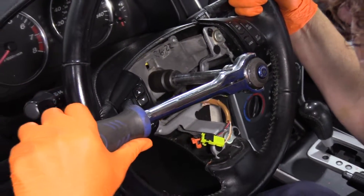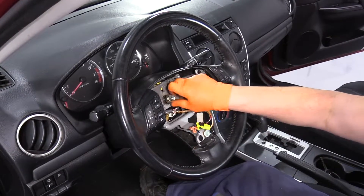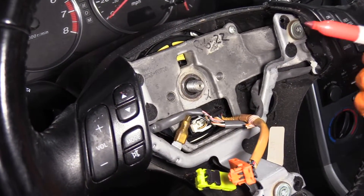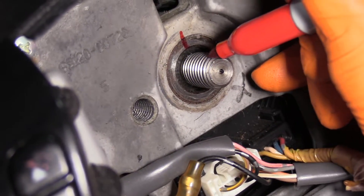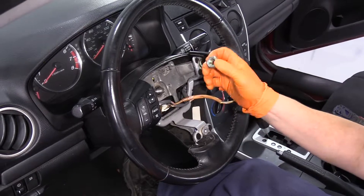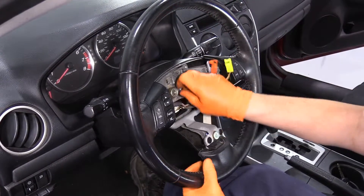Make sure your key is out in the lock position. You can take that nut all the way off. This is where you're going to need a steering wheel puller. After taking my mounting nut off, before pulling the steering wheel off, I'm going to make a mark where the steering wheel was centered — a 12 o'clock mark down on the thread to mark my column stud. You don't need a steering wheel puller every time; sometimes you can try just by wiggling the steering wheel back and forth. I'll put the nut just slightly back on and pull it back and forth. I didn't need a puller on that one.